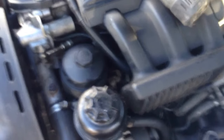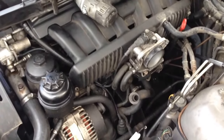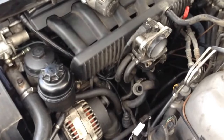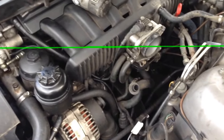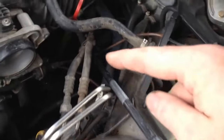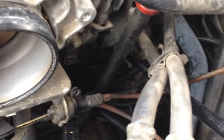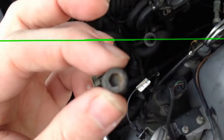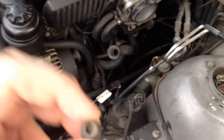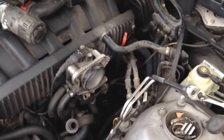I'm going to go ahead and pull that out and pull it up here to show you. Sometimes these bolts are really hard to get out — they're down the side of the engine block. A lot of times you go to put the Allen key on it and it strips out really easily; the metal is pretty much just trashed. So I ended up pulling out the housing. I take a 3/8ths socket with a really long extension on top of the bolt head — I'm hammering over the top of it because the Allen key is just totally gone. The metal is really soft. I hammered it over there and it got it out.